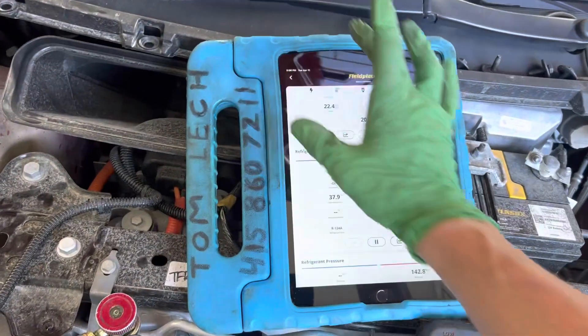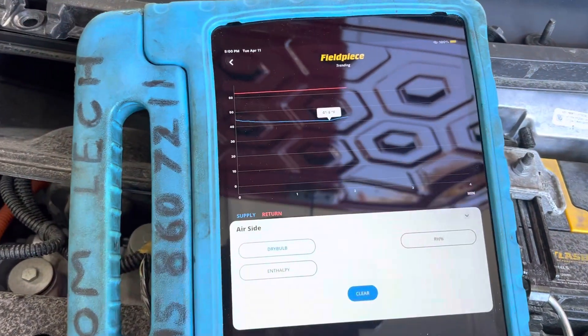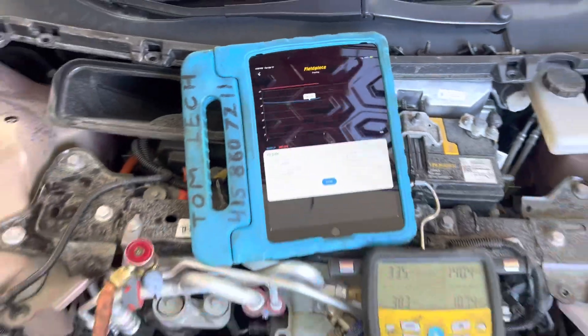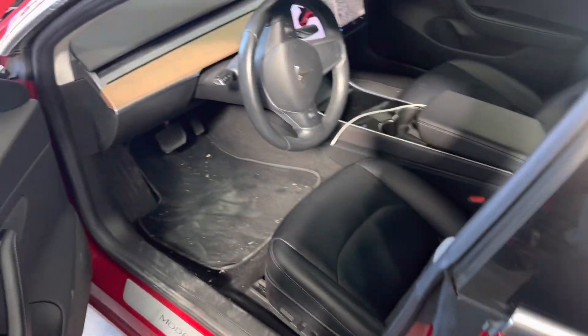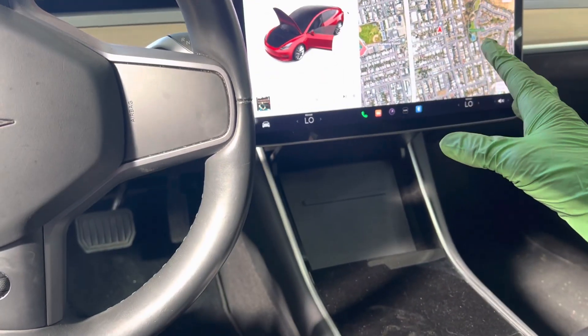Now I'll lay the camera on the chassis and you should hear or feel no vibration coming through the microphone. Temperature-wise, we got down to 41 degrees and it's starting to go back up. It's probably max cooled out inside — it's only about 63 degrees outside with no sun load, so there's no reason for the AC to go real cold. And don't forget you have your rear AC — turn your rear AC on back here.